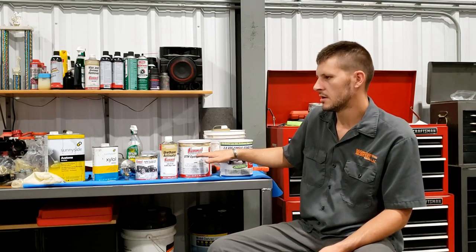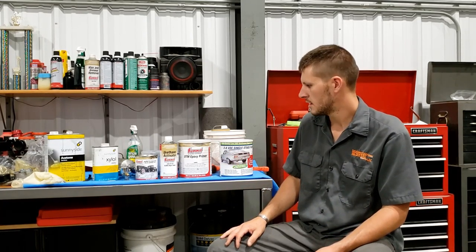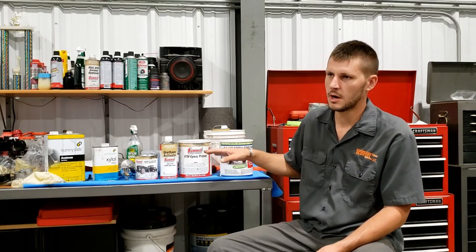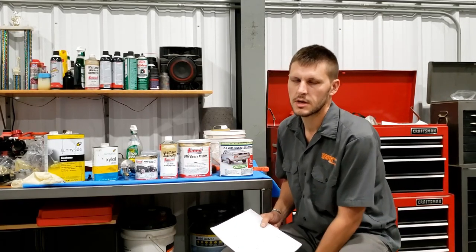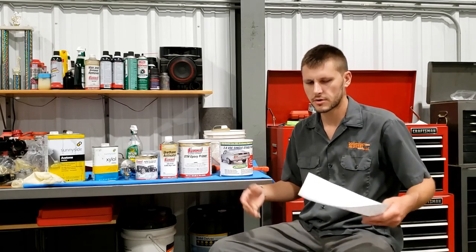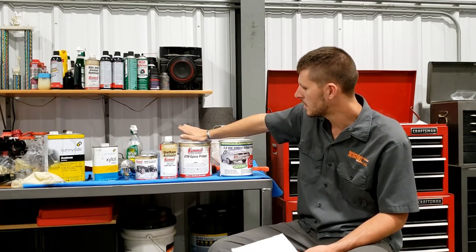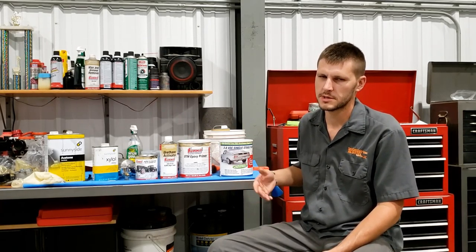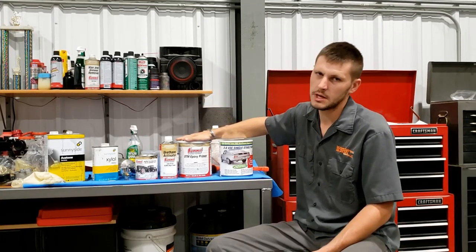my plan is if I see damage, I'm going to address it. But let's say I'm in the middle of the winter or something and it's not the ideal condition to go and touch it up. I want to know that the primer that's underneath my top coat that's now exposed is going to hold up to the road conditions until I can get in there and fix it. And so I don't want to go with a primer that's going to lift off and then let the contamination just rest against the frame and start rusting it out and create a bigger problem. So definitely a fan of epoxy primer now, and probably won't use a whole lot of self-etching primer anymore because of that. The nice thing about the self-etching primer is it comes in a can and it's super quick and easy to apply, whereas this is a two-part system. You have your primer and your catalyst, and you got to mix it up and put it in a gun and spray it.